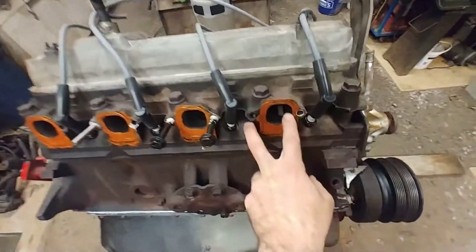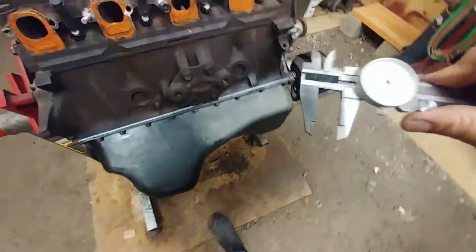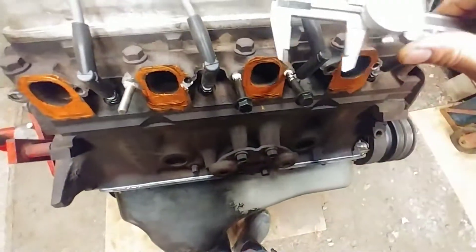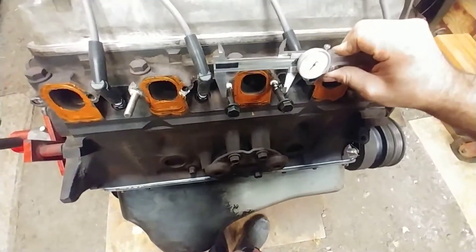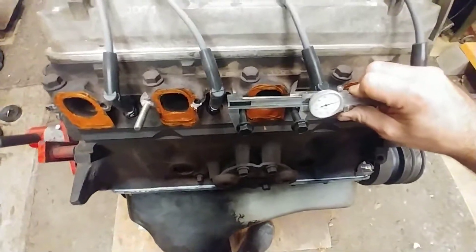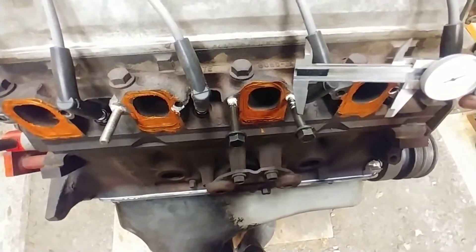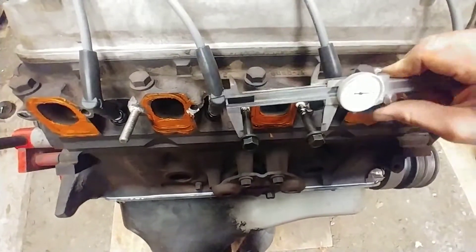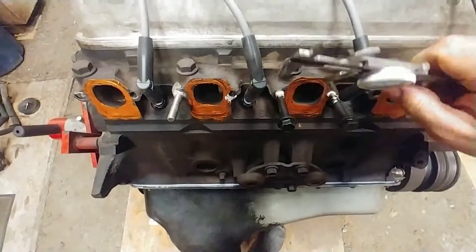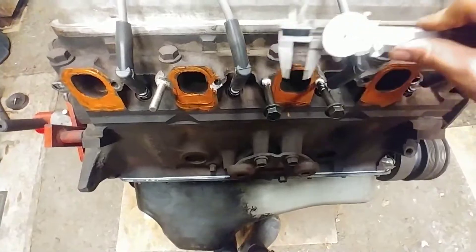So how do we control it? I've got to make a block that bolts up and can be clamped to this face, that already has a hole of the right size through it exactly where this hole should be, and use it as a guide to keep me completely normal to the surface - controlling the bit when it grabs and giving me reference so the drill bit tip doesn't break. I need a block of material of significant thickness with two holes on the exact layout. The garage method I'm using: a dial caliper. I put two bolts in until snug, then pull a dimension as close as I can to the bottom.